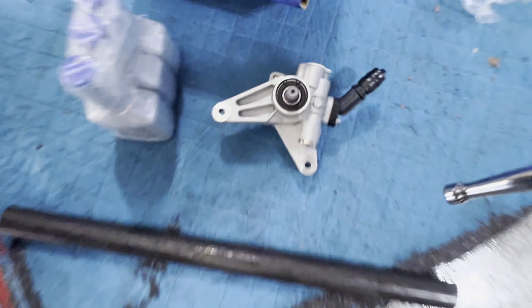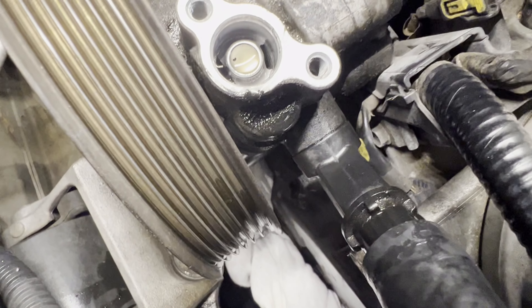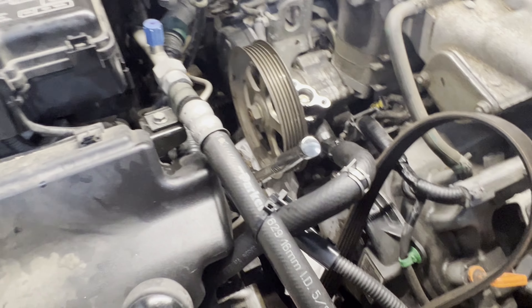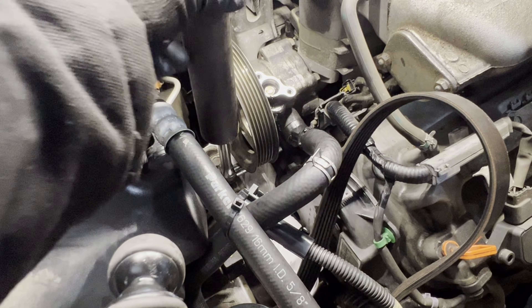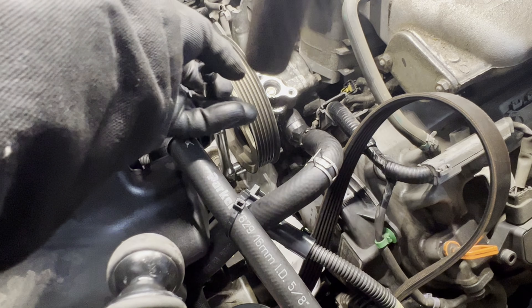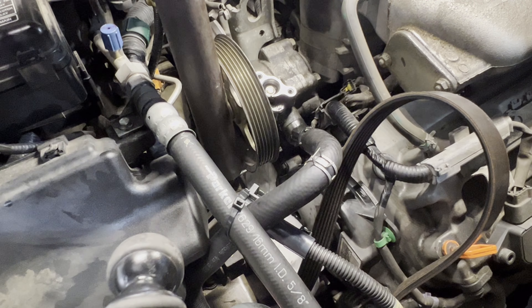It was still making that noise, especially bubbles in there, making noise on cold start. Get these out and put them to the side. This one should lift up pretty easy — don't force it, just go side by side. That's a new gasket right here. Now we need the 12 millimeter bolt — one over here and one down here.